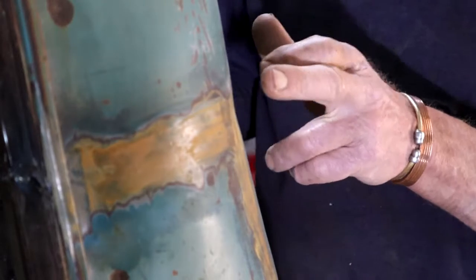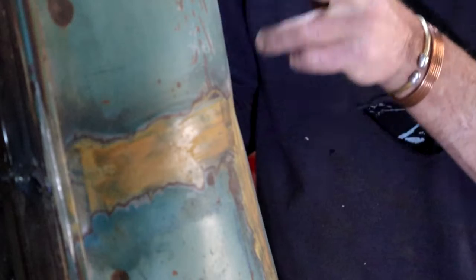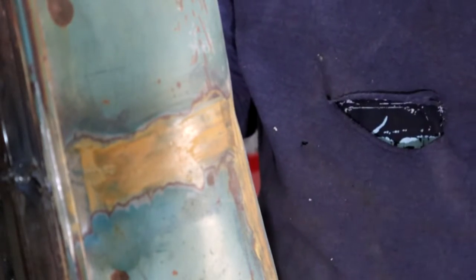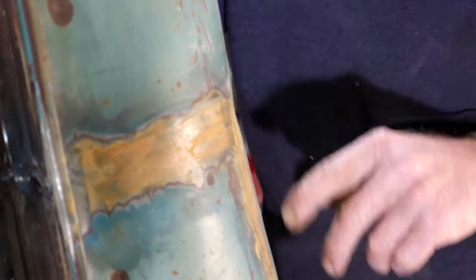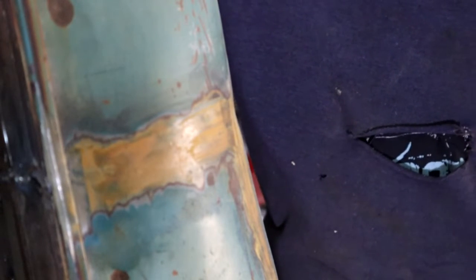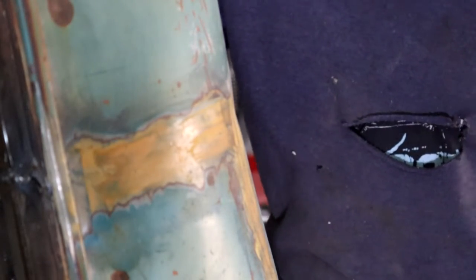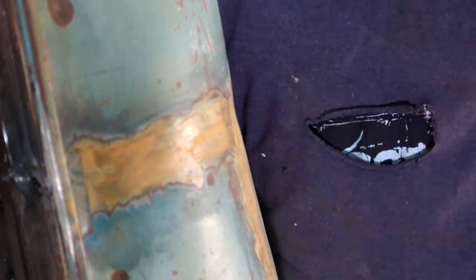And I thought I would just show you this. Quite close up, you can see a pronounced sort of indentation right there. That is of course because when we drop the roof, there's a change in the geometry of this whole business. The challenge here is you can't actually hammer and dolly it because it's double-skinned — so you can't get a dolly in from the inside. So yeah, if you wanted to do a fancy shiny, go-fast paint job, you'd have to use some Bondo here. But I think many of you know already how I feel about Bondo. Life is too short to be sanding Bondo.